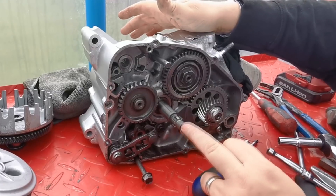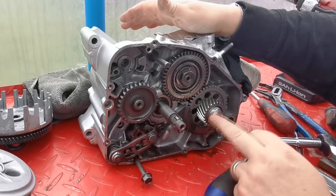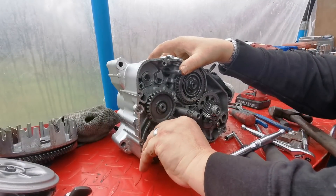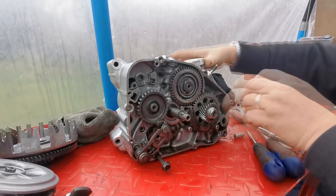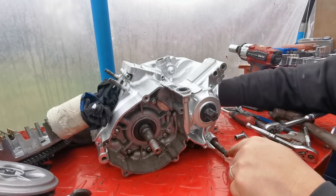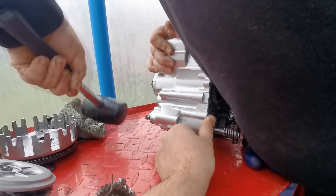Now as I said, there might be a ball bearing in there. But that's been well milled before as you can see - that crankshaft nut, or nut rather, so it might be worth getting another one of them. Gear selector shaft should pull straight through from the other side of the engine if I remember correctly. There we go - just drift that through. There's your gear selector rod.